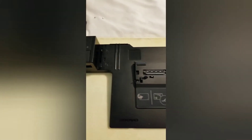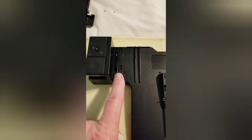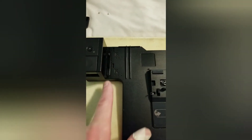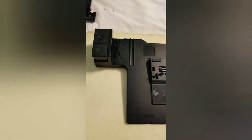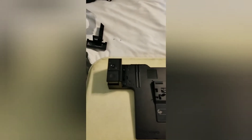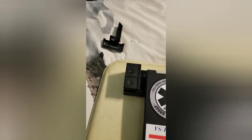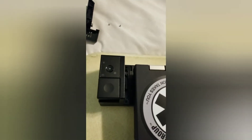Here it is all put back together minus the guide fence, the rail, and the two screws. It looks relatively finished — you could probably put a little tape down in there if you're concerned about getting debris in there. You can see when I dock up the T430 how much extra space there is now. One cautionary note: without the guide fence you're going to have to feel where it is and kind of let it drop in. You can see how much extra distance there is in there, and it doesn't take a rocket scientist to figure out that it will probably cool a lot better.